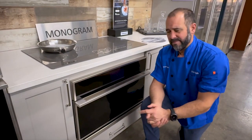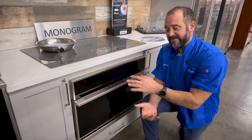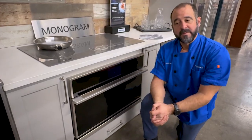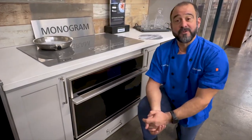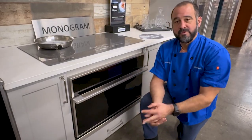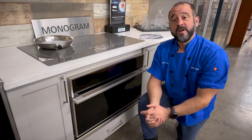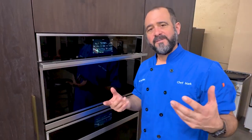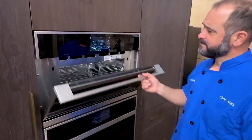Here you can see an Advantium oven mounted under counter. This is a very common installation if you're using your Advantium mostly as a microwave. It's a great replacement for a microwave drawer. And keep in mind the manufacturer recommends that you use the lower power standard 120 volt outlet if you're doing this installation. Let's take a look inside and see what we find before we start cooking.